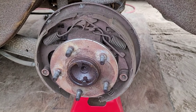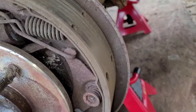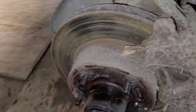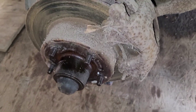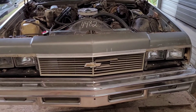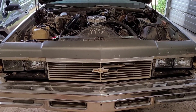We got one side off and it don't look too bad in there. I'll probably go ahead and replace that wheel cylinder just to be on the safe side. I need to find out on that other side if I got brakes leaking or axle fluid leaking. I'm going to squeeze up here and show y'all the driver's side. I'm going to clean the spiderwebs off, soak it down with penetrating oil, and hopefully it comes apart gently so I can get it back together, bleed the brakes, and have a good pedal. If I can't finish today, I'll come back tomorrow. Hopefully you're learning something.